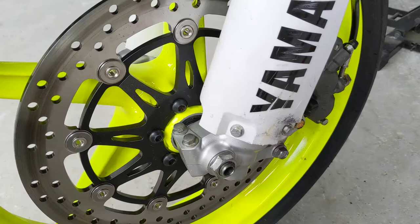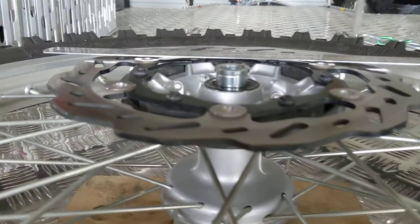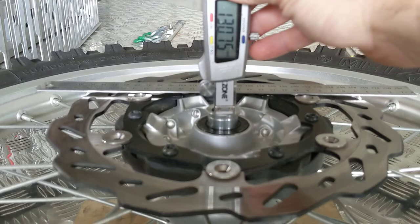Before part three, I want to show how to measure the wheel to set yourself up. This timber block has the bottom spacer, the hub, and the top spacer, and you literally just use your verniers in depth mode. You should get 130.75mm — so once all your spacers are set up for your front wheel, that's what you check: 130.75 millimeters wide including spacers.